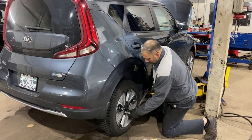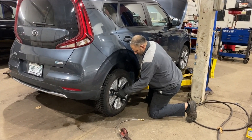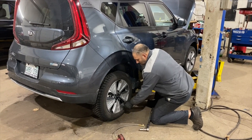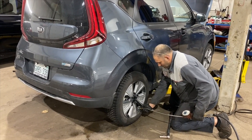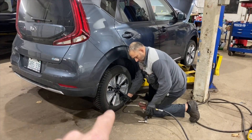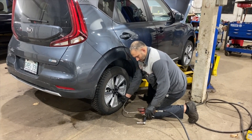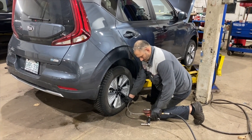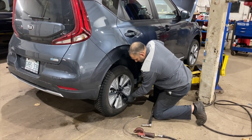One of the final things Chris is doing now is torquing the wheels — extremely important to make sure they're torqued correctly. You can always swing back in, and I'll have Chris check them again tomorrow as well. He's also checking tire pressures: just because you have tire pressure monitors doesn't mean you shouldn't verify the pressures manually. Tire pressure monitors don't work until the vehicle is moving and the wheels may warm up, so Chris makes sure the cold tire pressure is correct.